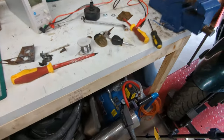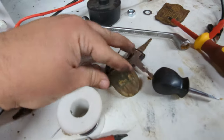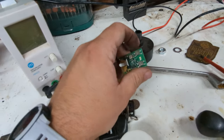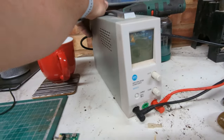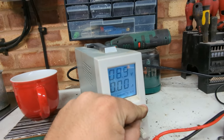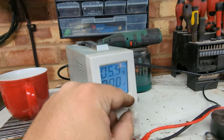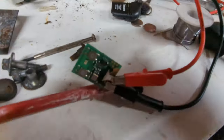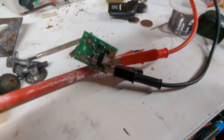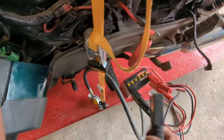I've got the key here. I had this exact alarm on another bike. It takes CR2016s and they are absolutely trashed in this — of course they are, they've been there for a decade. A CR2016 is three volts, so this is going to want six volts — we'll go slightly under. Turn the power on the bench supply and we should have a working fob. I'll order some batteries for it so we don't have to do this nonsense. Let's give this life again.